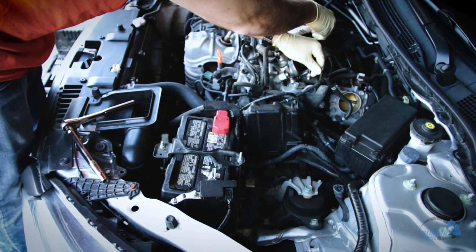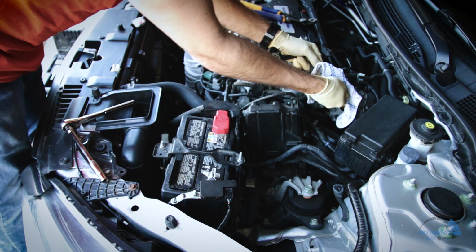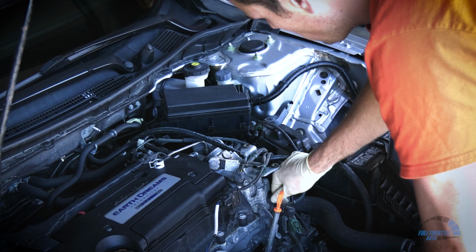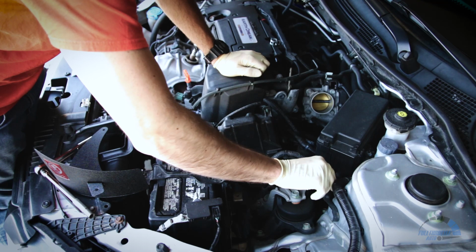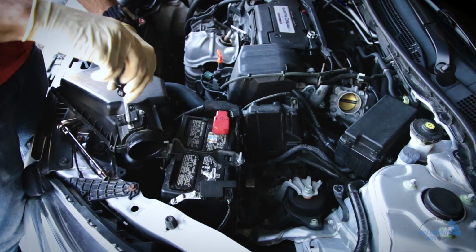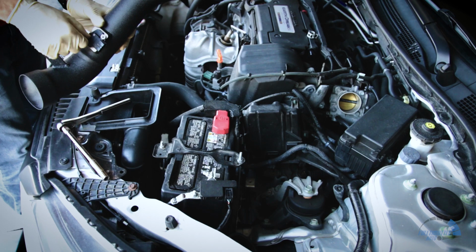These hoses will not be reused, however, you will reuse the clamps from the coolant hose only. Make sure that the car is cooled off before removing the coolant hose so there is no blowback from it. Once the coolant hose is fully removed, go ahead and put in the new supplied hose with the reused clamps onto the car and put the mini engine cover back on. Once all this is done, go ahead and install the isolation mount and put in the new housing for the new intake system. Once that is done, go ahead and get your new intake piping and put it together.